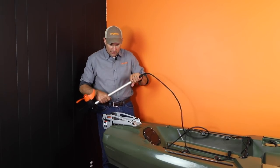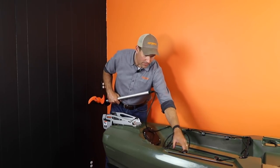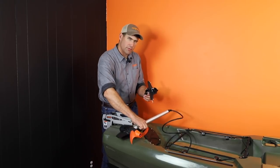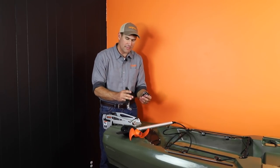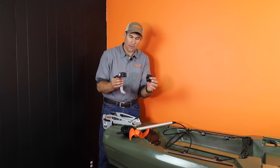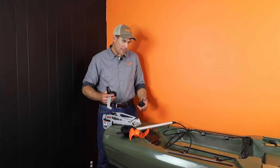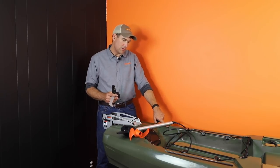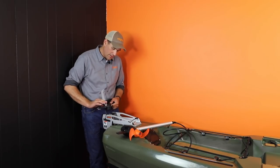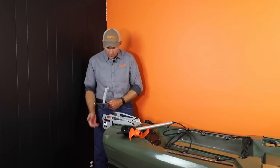Now we're going to talk about how you put the pylon into the mount and the black pivot drum, but more importantly, these two parts: which goes on first and which goes on second, and which hardware is on which of these, either the steering triangle or this spacer. In this particular case, we know that the lines to steer the motor are going to be coming out topside. They're going to come up here. So we want the steering triangle up here. We don't want it below.